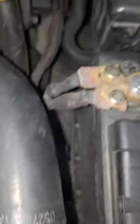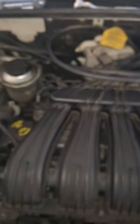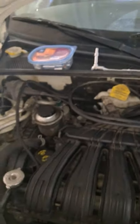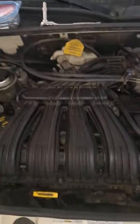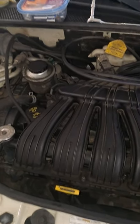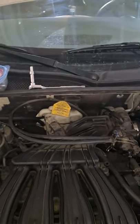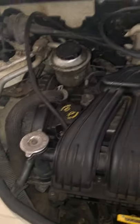Well, somewhere down there, I can't see where, there is an 8mm socket piece. Well, let's just say I actually found something to replace it with, and I found out what my problem was. This came off this. So it's letting way too much air in, so it's idling too high. So I gotta take my intake manifold off all over again and put that piece in and make sure it stays in. So make sure that when you're done with your mechanic work, that every piece goes back to where you found it.